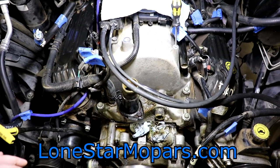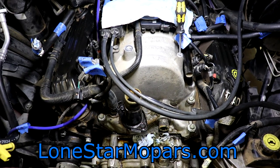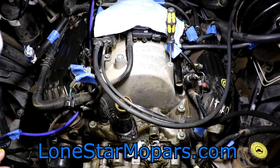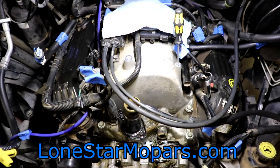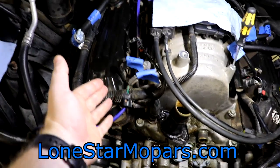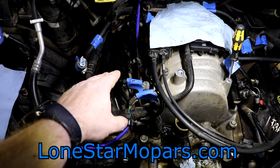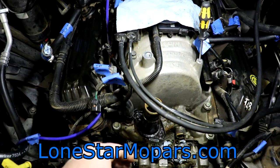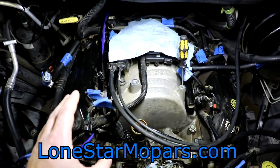I've made a little bit of progress, nothing major. You might see some more blue masking tape. This kind of seems overkill, but rest assured — if you're pulling your motor and you go back to connect it some number of days or weekends later — you might not quite remember things. The harnesses themselves sort of have a limiting factor. For example, on the passenger side we've got injectors two, four, six, and eight. It would be really hard to cross injector harnesses for four and six; six and eight you could conceivably do — they're in the same ballpark. So I've labeled some things. It's important to make note of the routing, because at some point you're going to have to put this all back together.